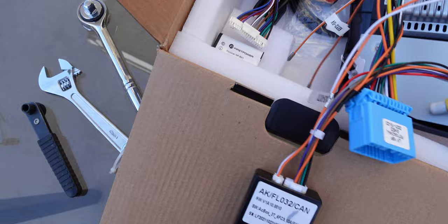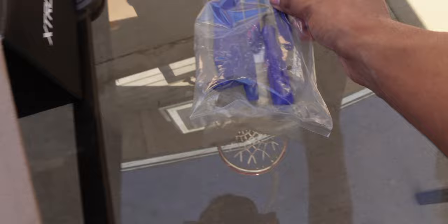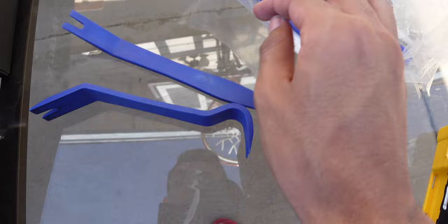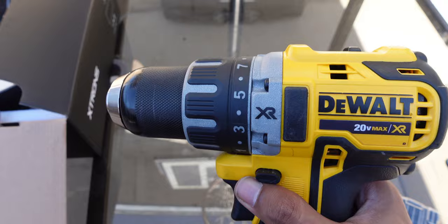The USB ports are specific — there's a six-prong connector that goes into the six-prong port, and a four-prong that goes into the four-prong port. If you have single zone AC, use the single zone AC connector. I also recommend getting one of these plastic pry bar kits if you're going to be doing a lot of car work. You'll need those pry tools as well as a power drill to remove the screws — there are three on top and two on the bottom.